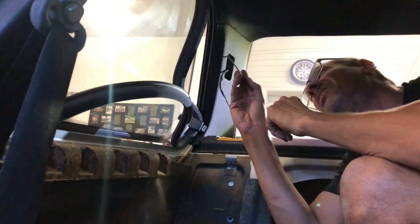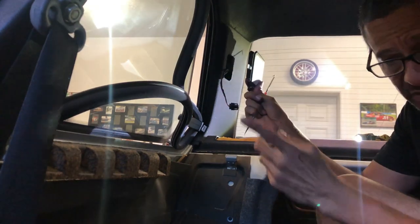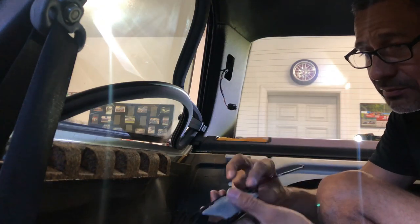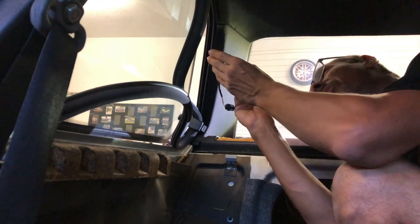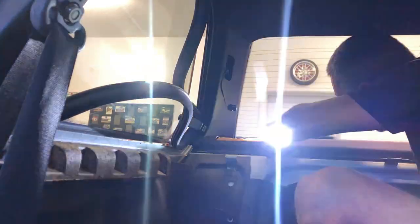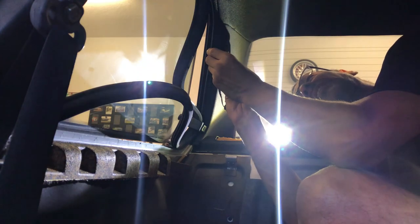Here's my pick. I can see it — I already got the light removed. All I had to do was use a little flathead screwdriver, get it in between, and gently pull on the top side until it comes out. It's just held on by little plastic pieces — no metal clips, very easy to remove, unlike the E46 ones. So here we go — I'm looking for that tab and I see it. I need to put my glasses on because of darn old age. Now I got it underneath the metal tab and the plastic piece.